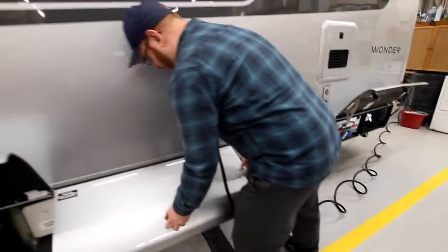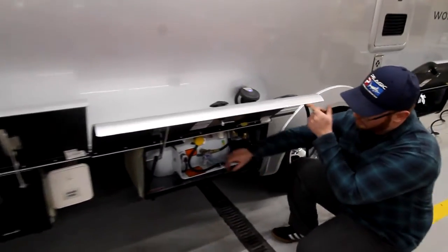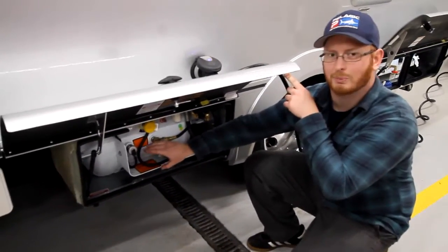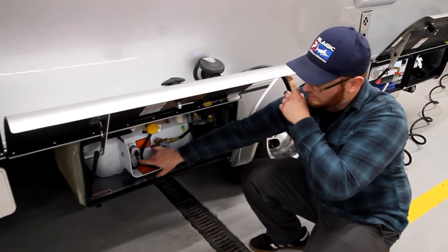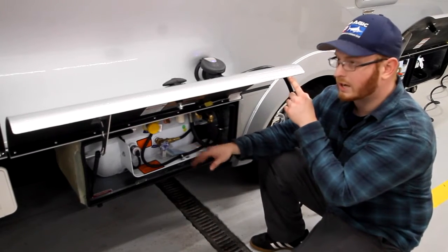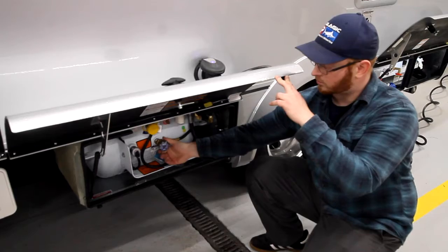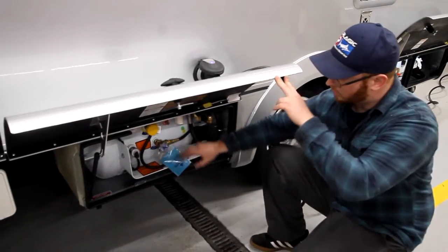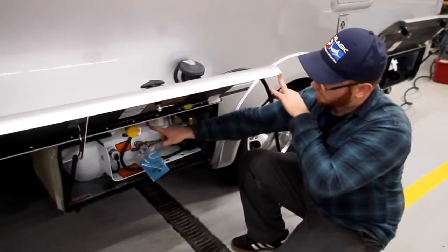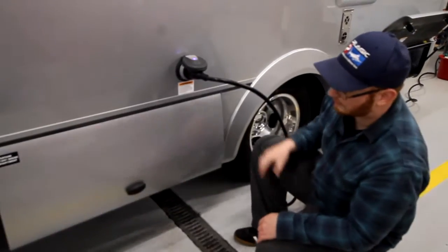Underneath here we have our propane. In our propane compartment, we have our gauge which you can see to check how full it is. You can see that this has wires coming out of it — those wires go to the inside so you're able to check the level of your tank from inside the unit. This here is your valve — turn it to the right to close it, turn it to the left to open it. Above this valve you have a yellow cap — that's where you fill. Make sure that's closed all the way as it allows gas to escape if it's open, and you don't want that.